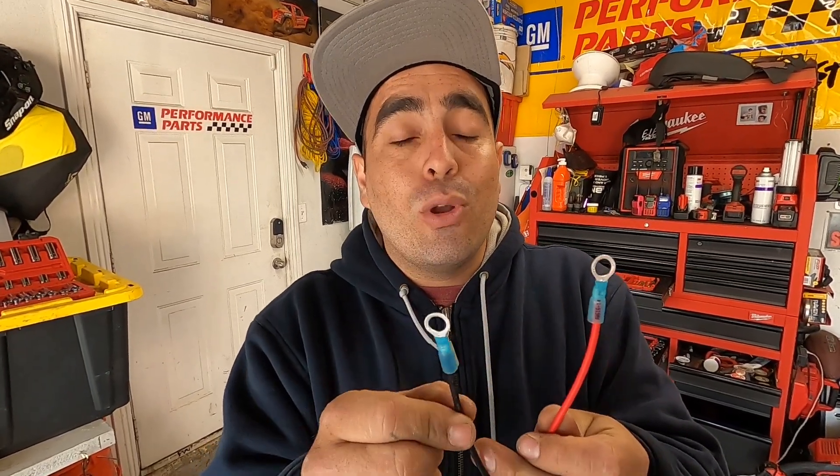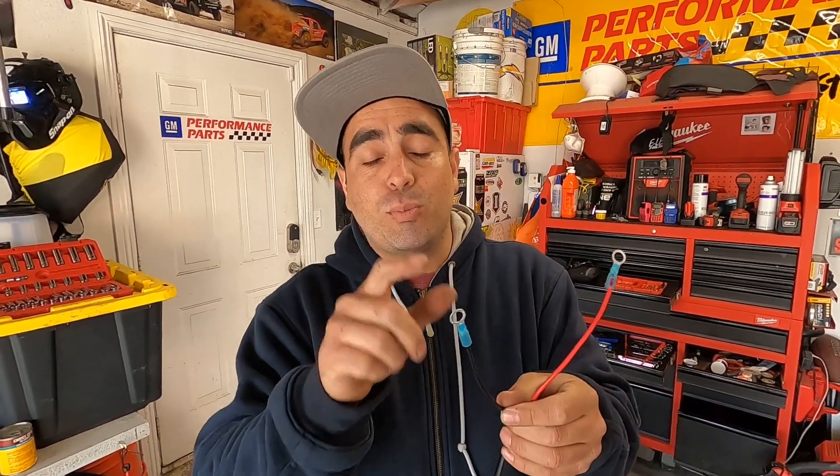For the control circuit I'll leave a link in the description to a video I made on how to wire switches and leave a control circuit from the switch that can connect to this and control this harness to turn on and off your lights. It's really really simple, not that hard, and you'll pretty much have a factory look and everything's gonna work out perfect. The only other thing about this harness I had to change is the ring terminals at the very ends — they were a little big for the junction block and fuse block on this car. So I had to cut those off and put some new ones. I'll leave a link in the description to an accessory kit that has a bunch of different connectors — spades, rings, and butt connectors.